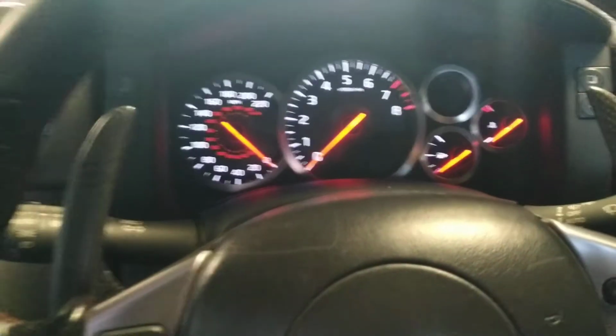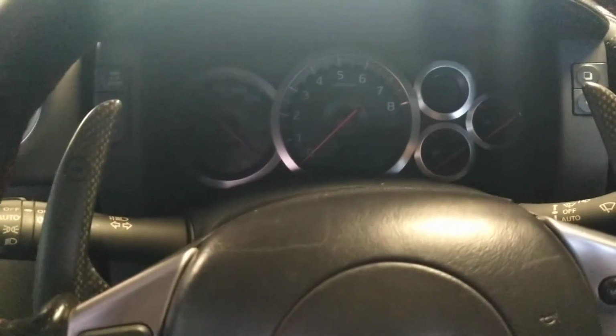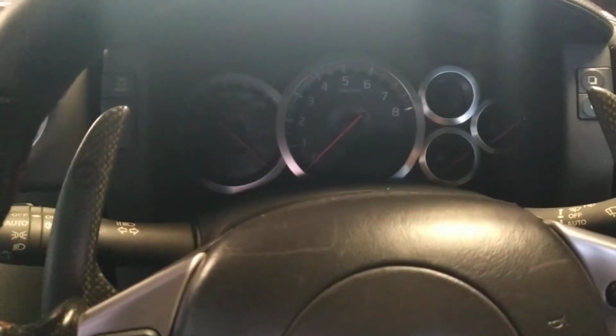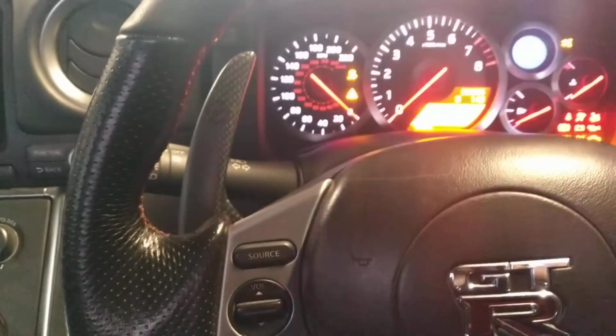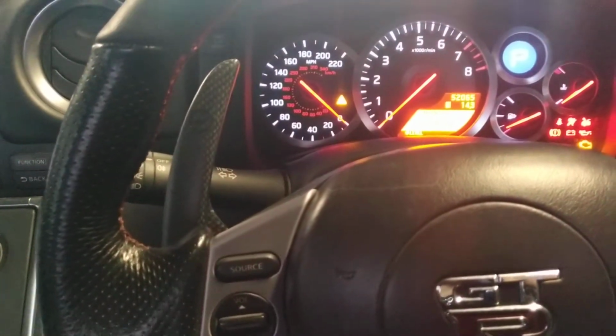When we turn off the ignition, within about 5 seconds, the vehicle will immobilise itself. So if someone was to clone your key, jump in and try and start it, this is what would happen. So foot on the brake, ignition on, try and start it, vehicle won't start. Really clever.